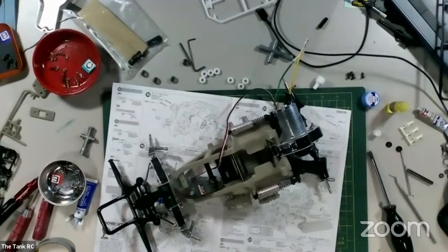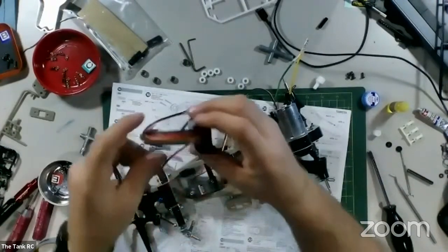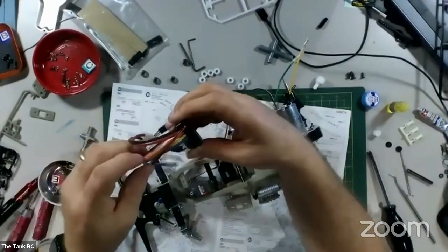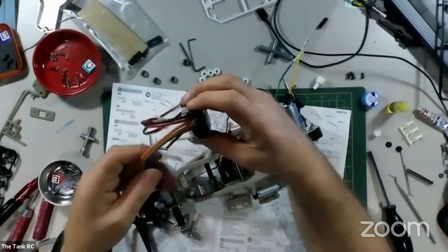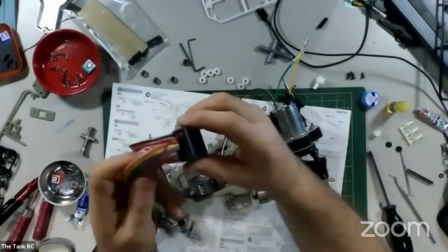Yeah, well, some of my cars came with real thin ones. I mean, they're not even a millimeter thick. Some of the cars come that way. Well, yeah, that's for race applications where you're trying to tune it. You're fine tuning the shock. Those spacers could be used where you stack them, take some out, put more in, that type of stuff. That's how you tune the shocks on these.